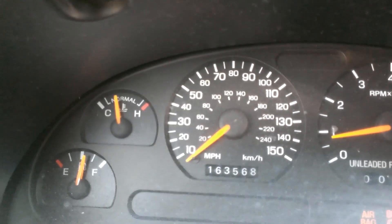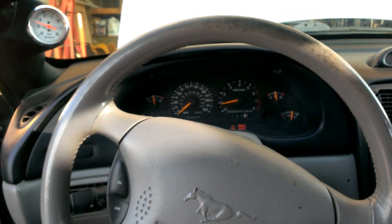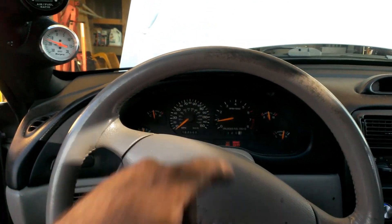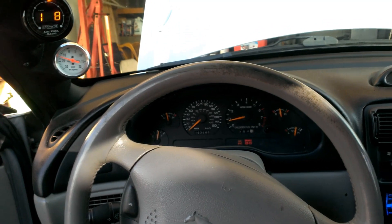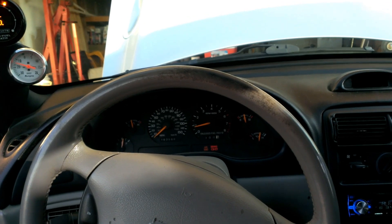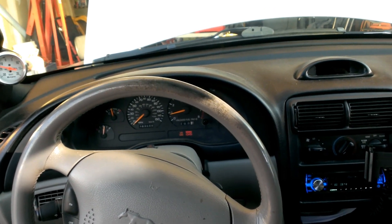Right now it's still way down there, but once you get driving it on a hot day, this thing sits right at the top. New radiator, been flushed, thermostat's new, everything's new. But I looked it up on the internet — for a '96 Mustang GT you just see tons of people saying they're freaking out. The car isn't overheating per se; it wasn't bubbling over. That's just where they run — about 230 degrees when you're driving them around, sometimes dropping to about 220 when cruising.